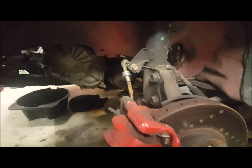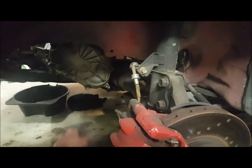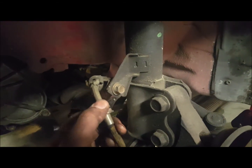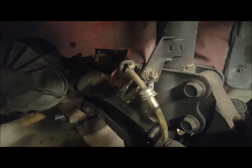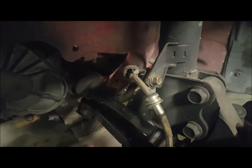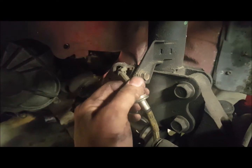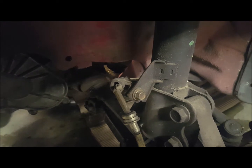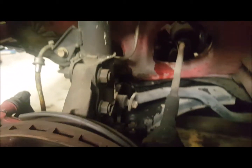And these are the MR2 braided brake lines. As you can see, the mount that goes to the struts is in a different place, but if you're wanting another idea of how to mount them, I went to the wrecker, and any Honda, like Civics and Integras, they've got these little brackets which hold the brake lines, which you can use for these. Then I've got a cable tie on each side to stop it from moving, but it's been like that for years and it's been fine. So you can just mount it however you want, any angle, bend it, whatever, and it works fine, sweet as.